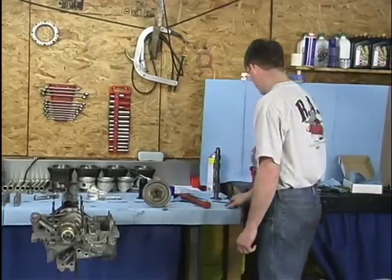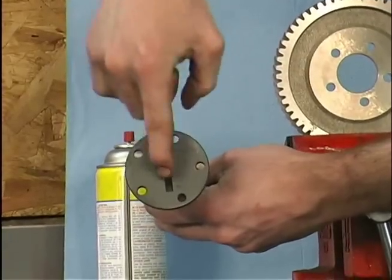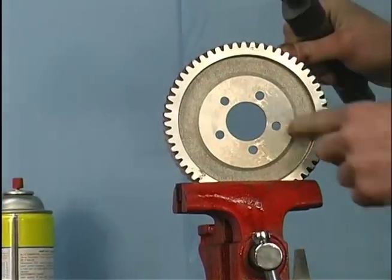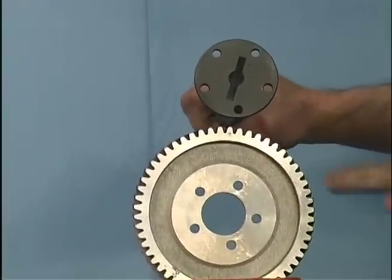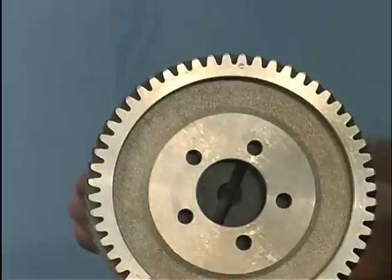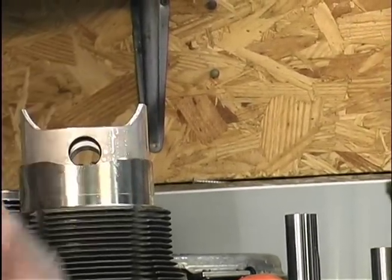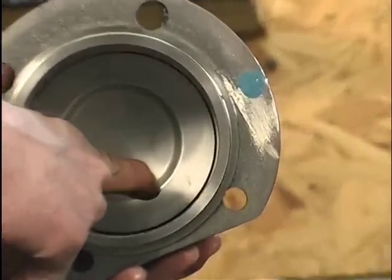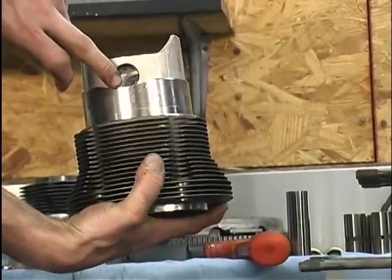When you go to your new cam, it's going to be exactly the same. The new cam has bolts with threads inside instead of rivets. It's good to put the cam gear in a vise because it's a tight interference fit from the backside. When you put this on, you want to make sure your dot's facing to the outside so you can align it with those two dots on the crankshaft gear. Use snap ring pliers and install the clip into the outside portion of the piston. There's an arrow here, and that arrow always needs to face toward the flywheel, just like on the Type 1 engine.